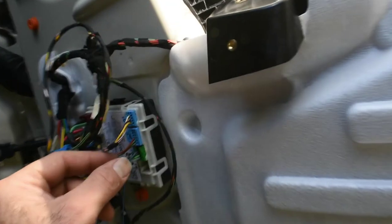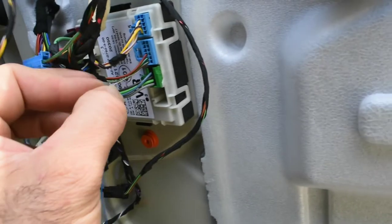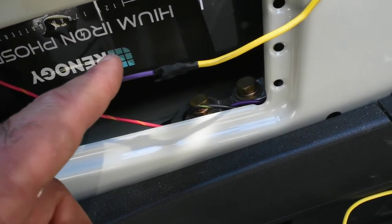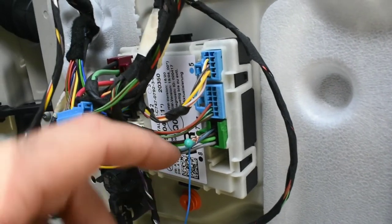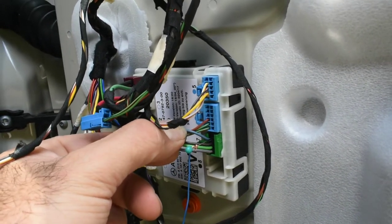What I've done here is I just stuck a little pin in to back-probe these. This wire is obviously not my finished product, but it's connected to the purple wire from the Power Steps harness, which is your passenger's door trigger wire. I'm just testing right now, but when I stick it in this slot with the blue wire from the door latch, it works. So I'm going to tap into this a little bit more professionally. For those of you trying to install one of these, this is the wire that you're looking for on the passenger side.